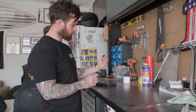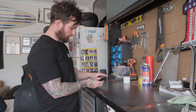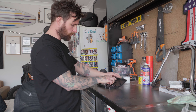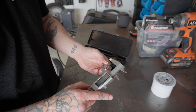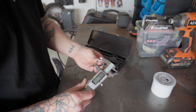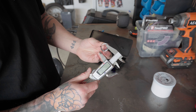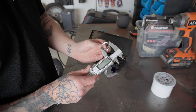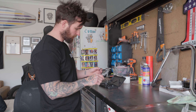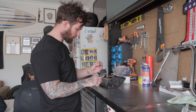When you've got your blue dot, grab something to measure the diameter of the hole you're going to need to make in your taillight. These are roughly about 23.5 millimeters, and the overall size before it falls in is about 26 millimeters — so there's not much room to play with.